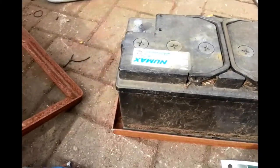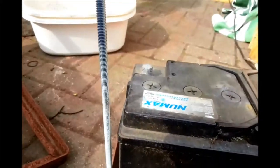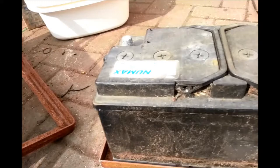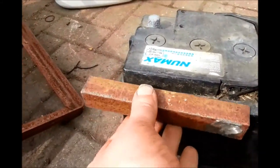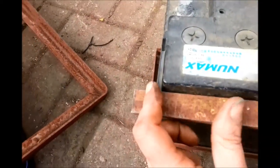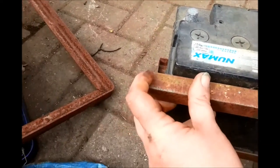It's quite a heavy battery. I think the way I'm going to go with the corner arrangement is just drill through and drop a piece of threaded bar through the side, put a nut on the bottom. Then four holes in the floor and bolt this through the floor. I'll put another piece of metal down the front of the battery — should be able to get the holes in this to match up with that and hold the battery down so it's not bouncing up in the air.